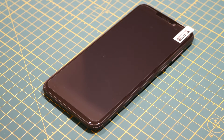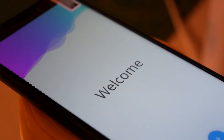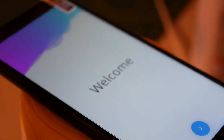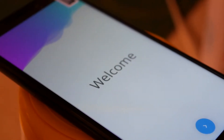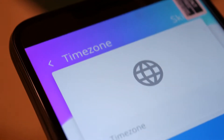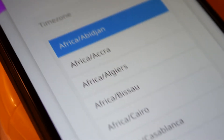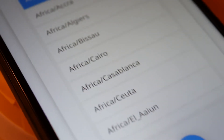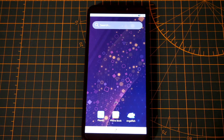At that point, I could just put the battery back in place, snap the back cover on, charge up the phone for a while, and power on the system by holding the power button. If everything goes well, you should see the onboard LED cycle through a couple of colors. There'll be an animated logo, and since it's your first time, you'll do basic configurations for your time zone, Wi-Fi setup, and your Linux username and password, which is probably also going to be the unlocking pin, so make sure it's a numeric code.